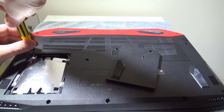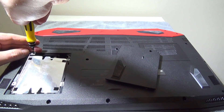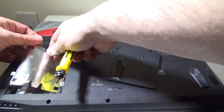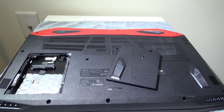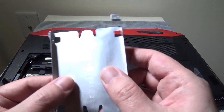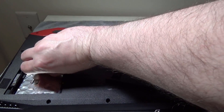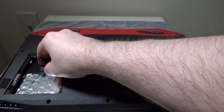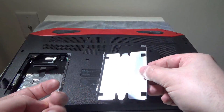If you want to upgrade the RAM — or maybe replace that 16 gigabytes with 32 gigabytes — it's a super easy process. Once you get the four screws out, you're going to want to pull this little sleeve out. It's kind of like a very thin metal sleeve that holds your hard drive in place. You have your SATA connector here that will be taped down to the bottom of the laptop and goes back to your main board, so you can just untape it and push the tape down — and there's your SATA connection.